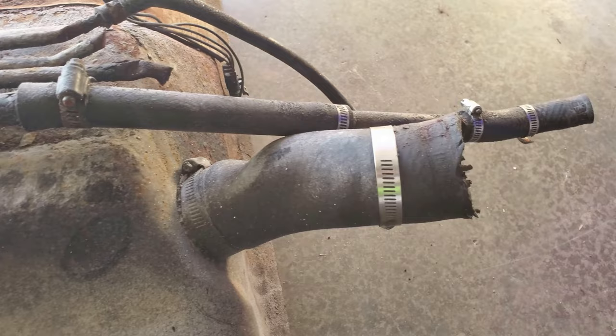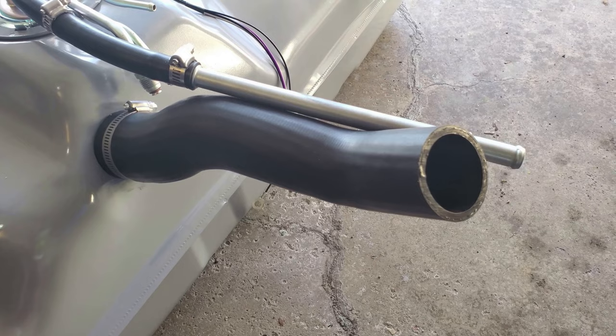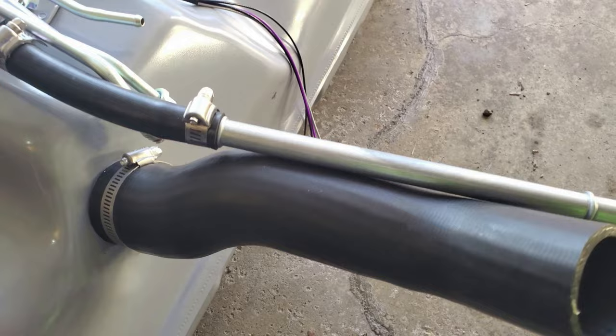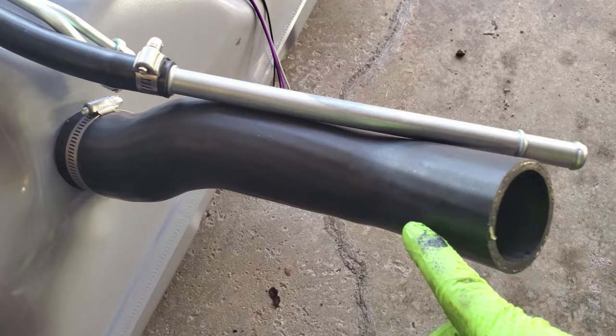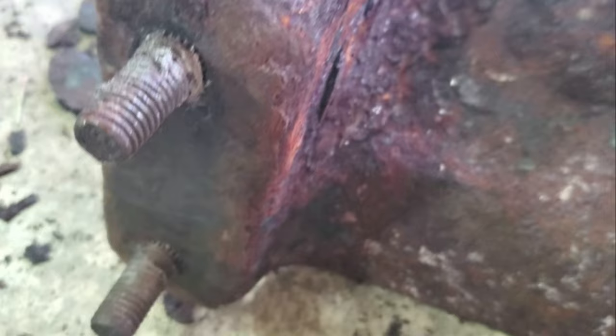The new kit came with a longer metal filler neck than the old assembly, so the old chunk of metal will probably be omitted. I tightened the clamp without crushing the plastic tube, leaving about a quarter inch of margin from the edge. I then took a rust brush on my drill and cleaned up the contact end where it goes into the frame, hammered off big chunks of rust, and will spray it with rust protectant.